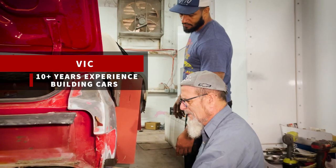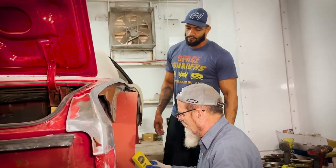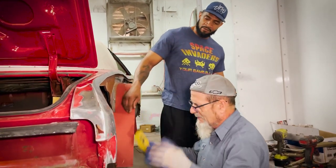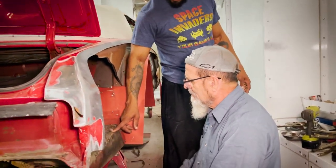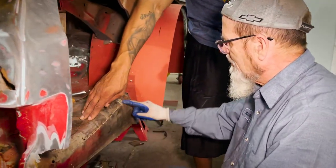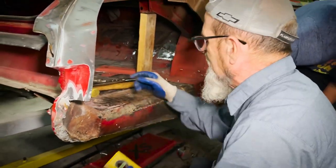This is good but it's kind of crappy welded, so I'm thinking bring it up higher, make one piece, weld that one piece into this setup. The thing about going up higher is we're going to go into the dimples here. We just notch the dimples and weld it right on each dimple like this. And then this one will square off because I just noticed, looking at this, that this is Bondo.